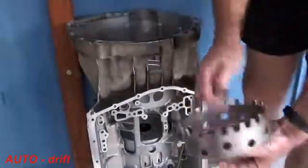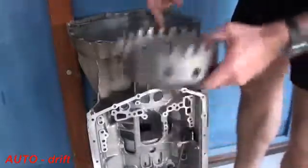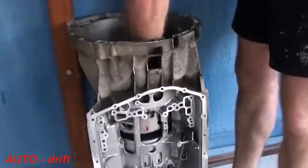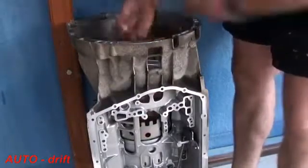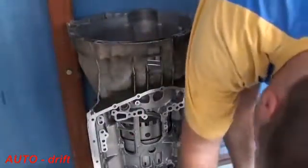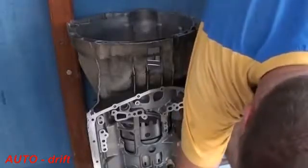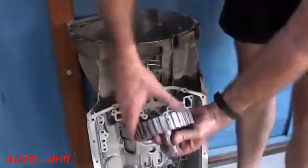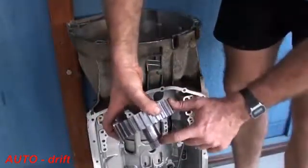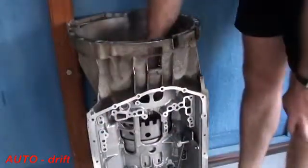these three pieces. The first one is the smaller of the two ring gears, which is the big outer piece. There's the bearing set that sits on top of that. Now got this one. This is the inner spline for the A clutch. And this spline here at the bottom actually runs into the larger of the two sun gears for the Ravigneaux set.